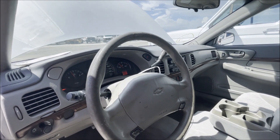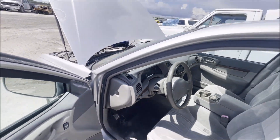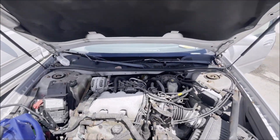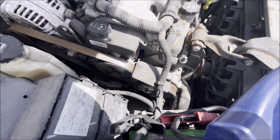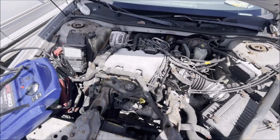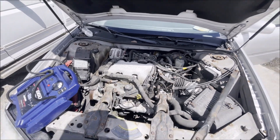Door ajar - anything else? No. I don't want to stick my head in this thing too long. This is an interesting one. Is our AC compressor engaging? It is - it is for sure. I think it's also low on Freon because it's not blowing that cold, especially in this heat. That engine sounds like it runs real nice to me, that's all I can say. But we've got some concerns with the rust and the flooded condition.